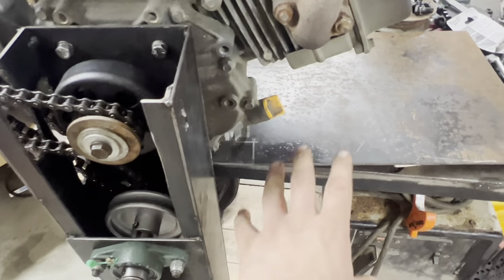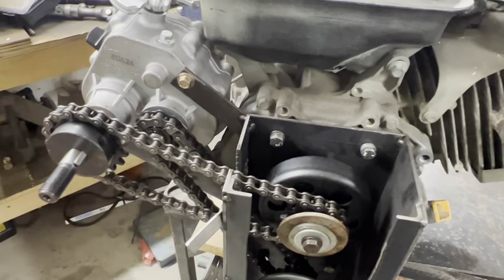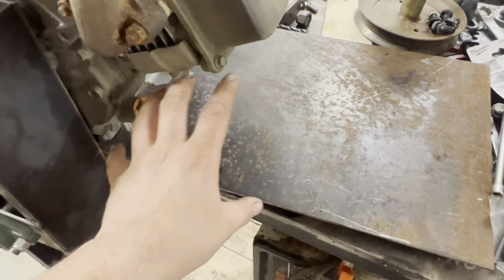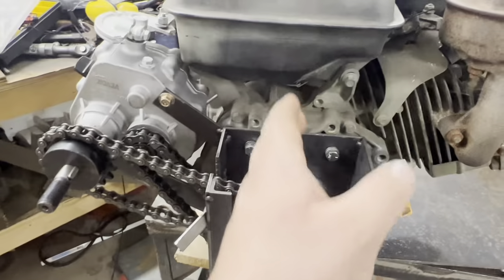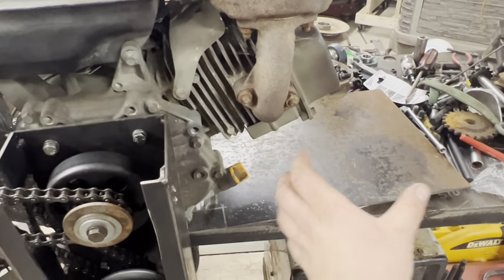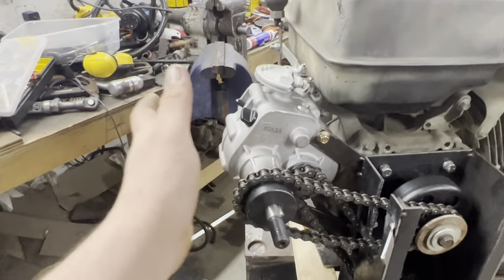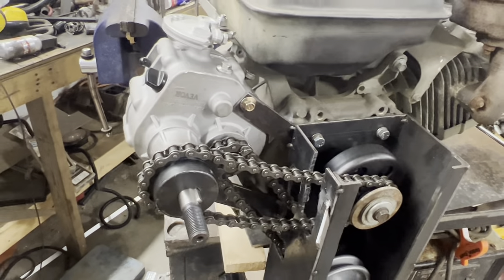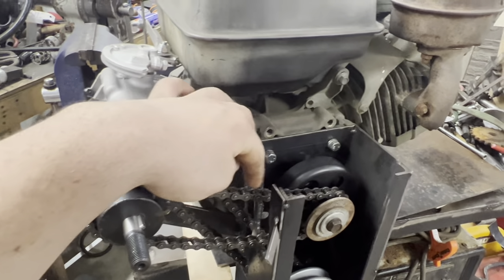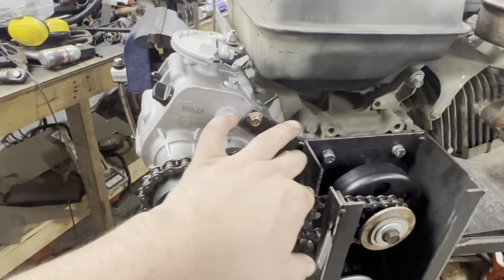My initial plan was to mount it right here because he wanted electric start, but I realized it's like $300 for electric start on one of these - you need a new flywheel, new starter, everything. It's a pain, and it would have been big and bulky. This is actually a little bit more compact than I originally planned because I was going to have everything centered off the center shaft of this motor. I didn't want super long chains running back and forth because then you get slop. The idler is actually going to go on top because the load part of the chain is on the bottom since it spins this way - so I'm going to put an idler up here that pushes down.